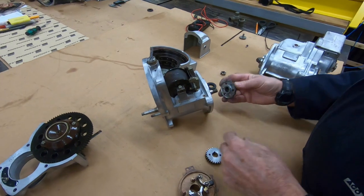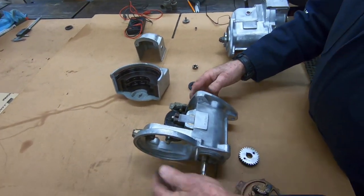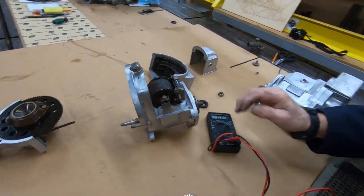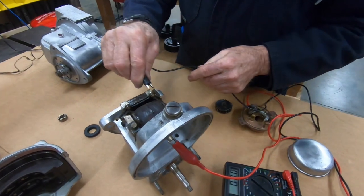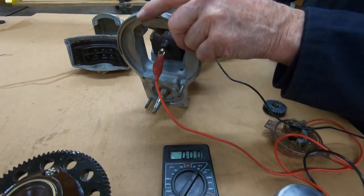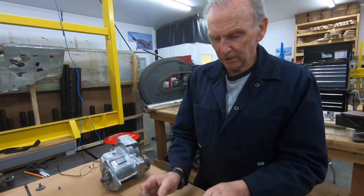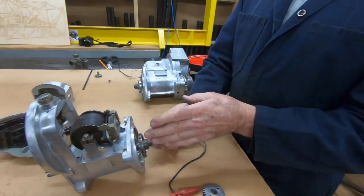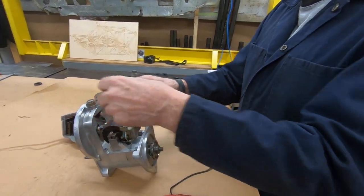We can show you with a multimeter here how this thing works. This is without the contact points — it's just to show you that we do have continuity through this coil. When I spin this, it shows up on the multimeter. You can see it's generating power just by the magnets going by the two coils. As you try to turn this thing, you'll see how the magnet pulls it back — it shows you how free the armature is. Every time one of those four poles crosses here, it creates a magnetic induction through the side poles through the coil, which generates electricity.